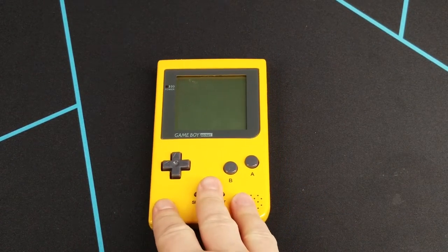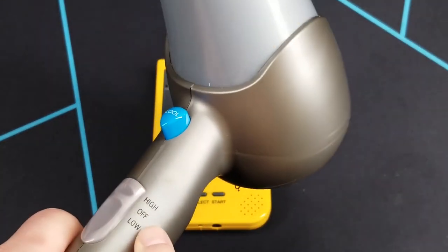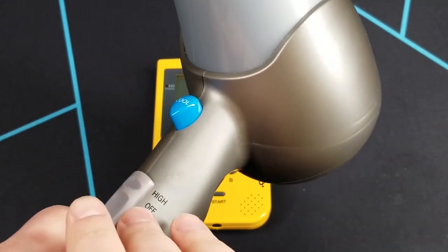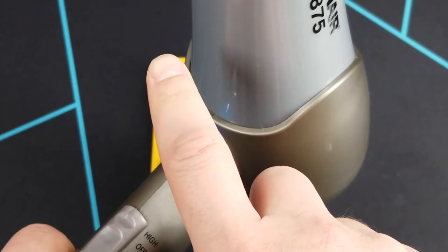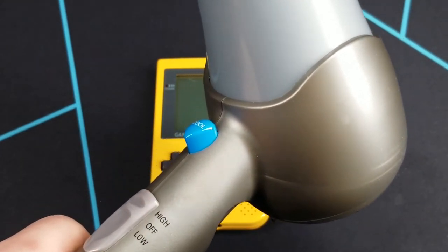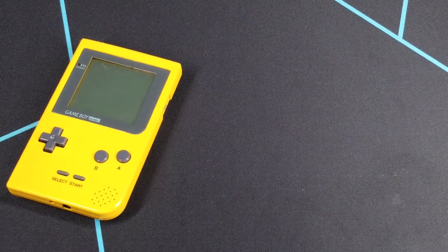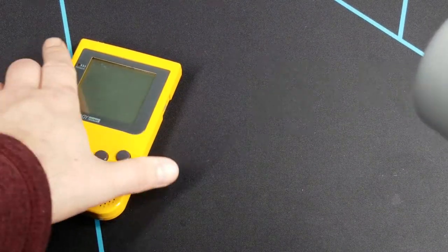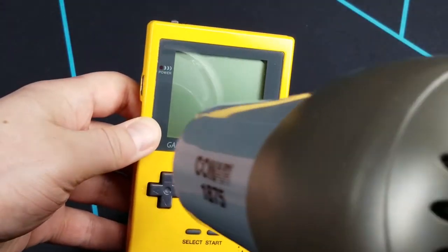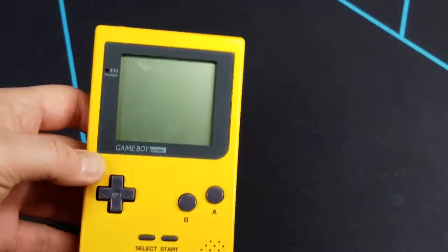I apologize, it's going to get a little loud — maybe I'll do a voiceover during this part. I have this basic hairdryer with a low setting. Make sure that the low setting on your hairdryer still has heat and isn't just cool air — this one has a separate cool option, but some hairdryers' low setting might be cold air, which won't help. Basically, you're going to go in a circular motion, applying heat as evenly as possible to help remove the screen lens evenly as well.